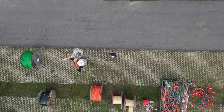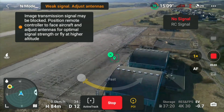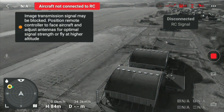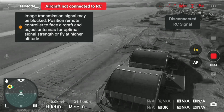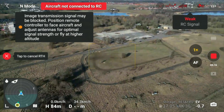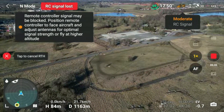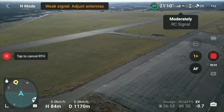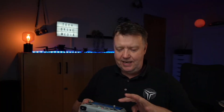Remember the direction of the built-in antennas — if you get into signal problems, simply point them towards the drone and you'll be fine. In cases where you lose connection entirely, the automatic return to home will kick in. And in real-life scenarios I've seen that as the drone returns, it can reconnect mid-flight so you can abort the return and continue flying.